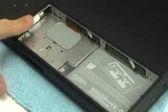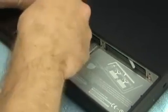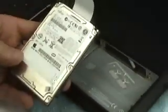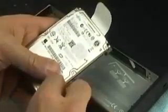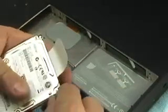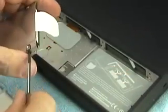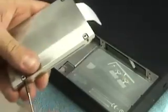All you have to do to remove the hard drive is very simple. On the left side you'll see there's a little tab — grab hold of that tab and you've just pulled out the hard drive. Here I've just removed the factory stock 5,400 RPM Fujitsu hard drive. You can replace that with a high-performance 7,200 RPM drive from Hitachi. We also offer large mechanisms from Seagate and Western Digital for these units.